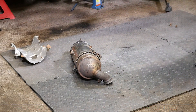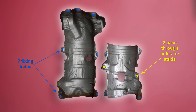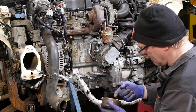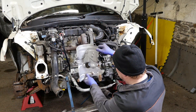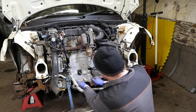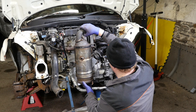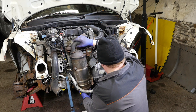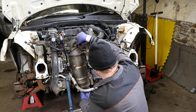That bolt needs to line up with the temperature probe, otherwise the heat shield won't fit back on. There's a quick reminder of the two heat shields. I'm going to put a little bit of copper slip on these two mounting studs because this was all very seized when I tried to remove it originally. We pop the backing heat shield on first, slide that on, then offer up the DPF and poke it down there past the air conditioning pipe - that's roughly in position now.